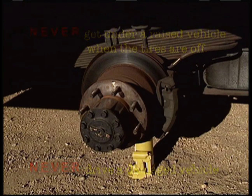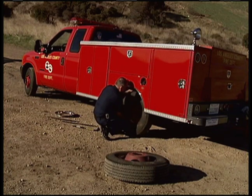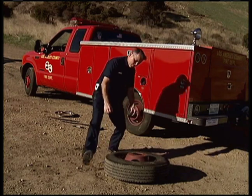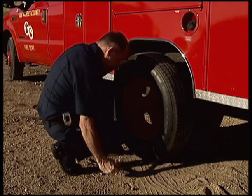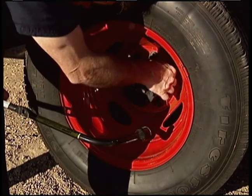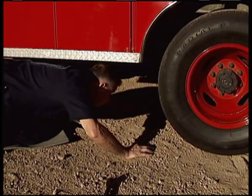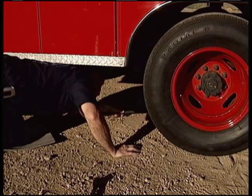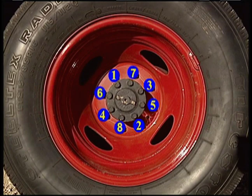Never drive a damaged vehicle. On a dual wheel axle, place the newer tire on the inside — the concave side of the rim should face inward. Then mount the outside wheel with the concave side facing outward. Use the lug wrench for leverage to help lift the tire onto the studs. Make sure to align the handholds of the rims with each other, and the valve stems should be on opposite sides. Reinstall lug nuts and hand tighten evenly. Lower the vehicle and remove the jack. With the vehicle on the ground, finish tightening lug nuts in a criss-cross pattern. Remember to re-tighten lug nuts to factory specifications within 100 miles.